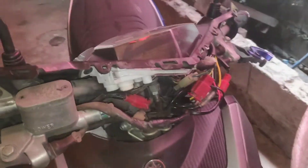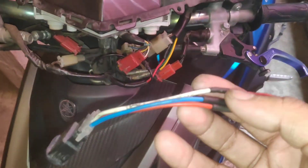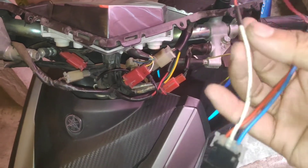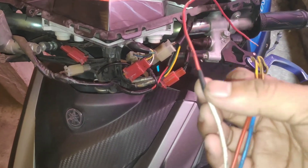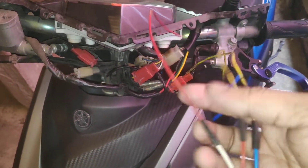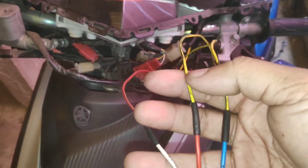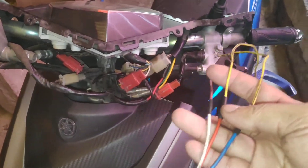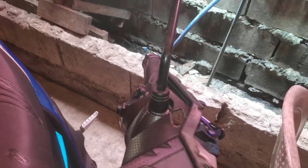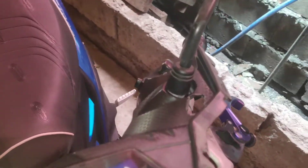Let's get started. What I did first since the wires might be too short is I extended them — I connected additional wires. The white one is important to note because that's where our supply comes from. I used red, blue, and orange — any color is fine since they'll go to the left and right turn lights respectively. I also drilled a hole here where I'll place the hazard light switch.